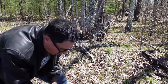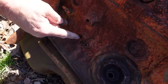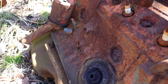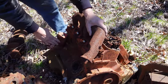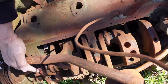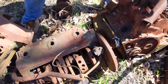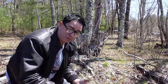These are called the Y-Block because the block skirt comes down in an extension here. Viewed from the front, it's not a V - it's more like a Y. This extra metal was meant to make the crankcase and block more rigid and stiffer, allowing greater power without things moving around. This is a modern five-bearing design, as are most modern American V8s. The flathead, by contrast, was a three-main bearing design - which means the center cylinders are not supported, so these love to puke the crankshaft out the bottom at Bonneville. Ford went to the five-bearing design with the Y-Block in 1954, securing the crank much better.